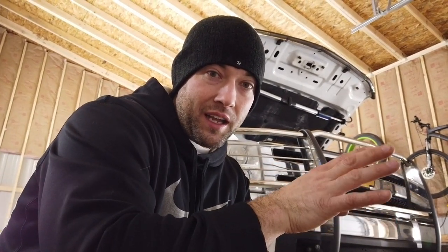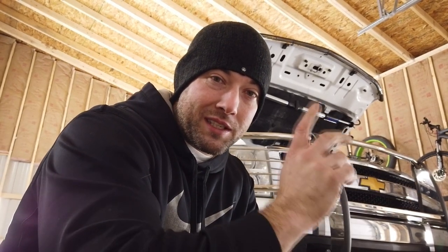Alright, so I'm not finished yet. While I was underneath my truck, I found that I have an oil leak — it's not like a serious oil leak, but I have an oil leak. It looks like the oil filter side oil pan could possibly be leaking at the pan gasket. I'm not really sure at this point because if you drive for a while like that it just kind of runs everywhere. At first I looked at it and I was like, oh crap, my rear main seal, because it looked like it was coming out at the bell housing. But the more I looked at it, I started finding it higher up on the engine, up past the oil filter.